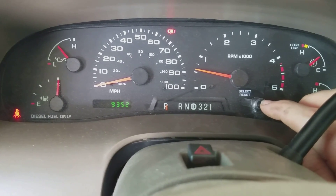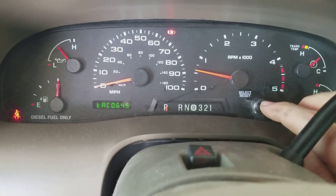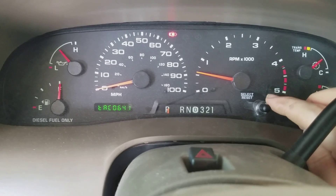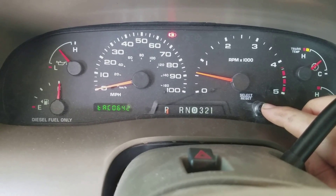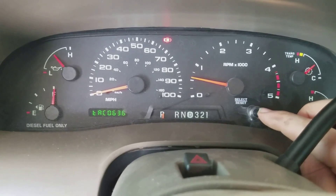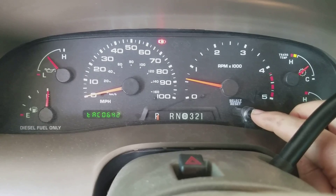There's another one right there, which I do have a tuner on this truck so I'd expect some. But there's the tach function right there — like I said, my main interest was finding that for when I do the high idle mod. It is running a little rough; I got some injector issues. I just put some Hot Shot in it for the first time, so I'll see if that straightens everything up — I'm hoping so.